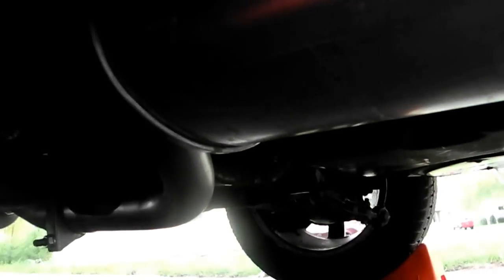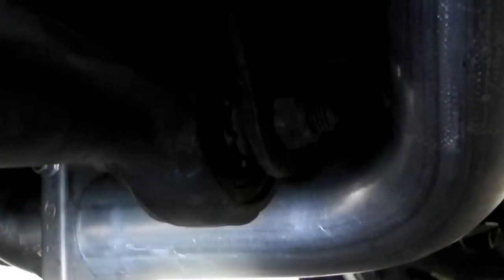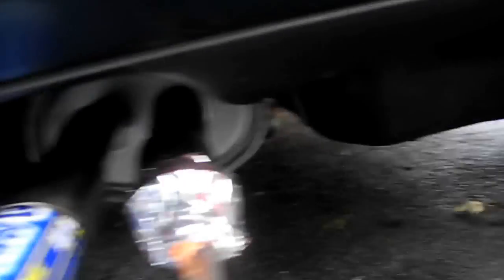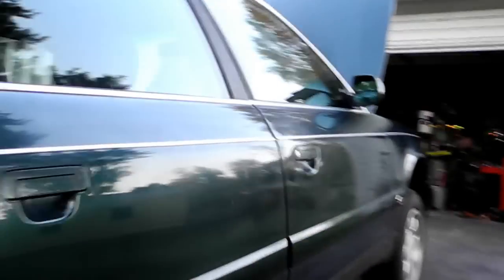Now it's hunting time. We're looking for a leak. And you can see there's smoke in there. This exhaust is all new and I'm having a hard time finding that smoke coming out of it anywhere. There's some flashlights in my pockets here. So that's one suspect hose there. I don't see anything coming out of there. Still got smoke coming now. You can see a little coming from around that opening. And here's the other suspect.